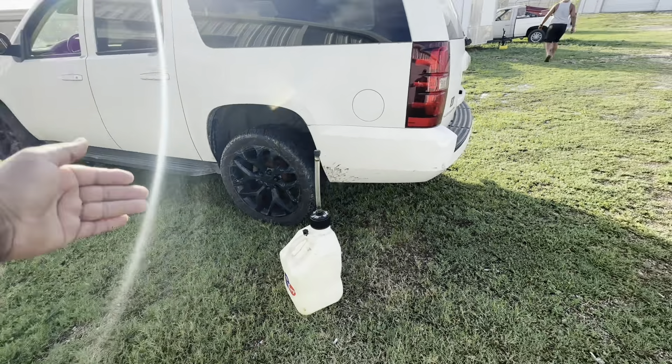Now I'm doing this on the street just because it loads up a lot more on the street than it does on the dyno. I don't take it in third gear on the dyno just because the driveshaft would be way over hundreds of miles an hour and I'm not trying to throw a driveshaft on the dyno. Either way, there's way more weight street driving a Suburban than rolling on a dyno without proper loading. I was doing inertial ramps and the truck made about 260 horsepower and 290 torque. I'm gonna put this in there and see if I can add timing.